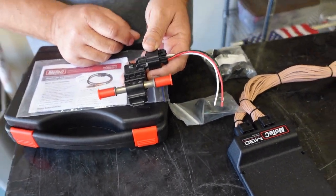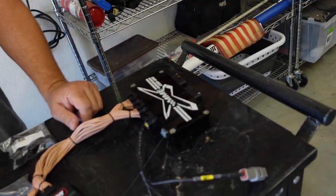A lot of your newer cars, even the pickups, have flex fuel. How does your truck know if you're running 87 octane or E85 when you have a flex fuel truck? It's got one of these doodads. This reads the alcohol content and changes your tune based upon the alcohol content. So imagine — everybody's testing for E85, it's got to be exactly E85 or at least E84 when you do your testing, because that's what your tune calls for. Well, since this is a constantly adjusting thing, I can go half and half, 91 and E85. As it runs through and I keep putting E85 in, it's eventually going to be all E85. And if I pick up some E82 or E90 that comes out of the pump, this will adjust for it and maximize performance based on what it reads.